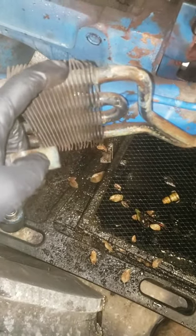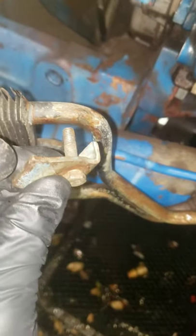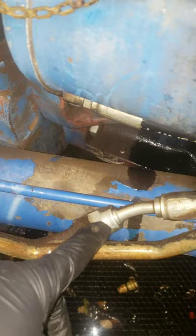Some designs are a little bit different — sometimes they don't have this little cooler right here, but unfortunately ours does have it to cool things down because we pull a lot of heavy stuff. It takes a 10 millimeter socket to remove the bolt up here, which mounts onto the cooler. That's step two. And this is a 7/8 to remove this fitting and this one as well.